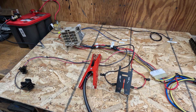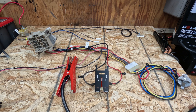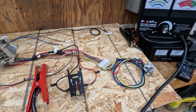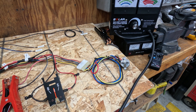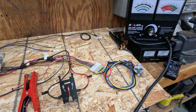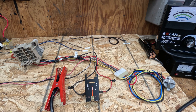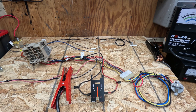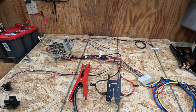Back at the fixture to demonstrate how the C-body recall was supposed to work. As a review, this is the unfused power distribution wiring from a typical Chrysler product from the 60s and 70s that did not run a shunted ammeter — standard ammeter configuration: E-bodies, B-bodies, A-bodies, and also C-bodies through the early 70s before they went to a shunted ammeter.